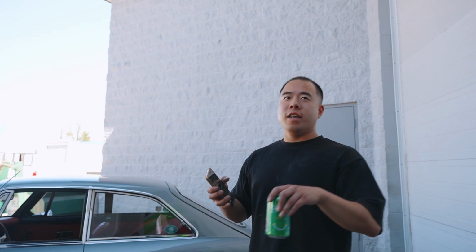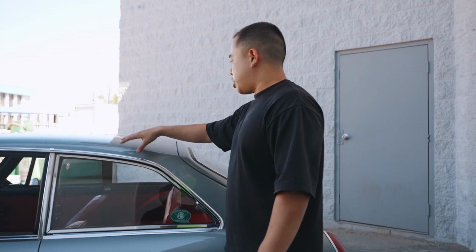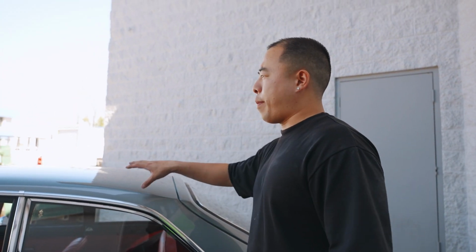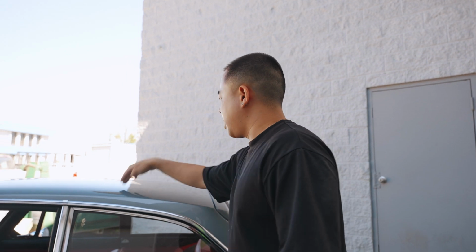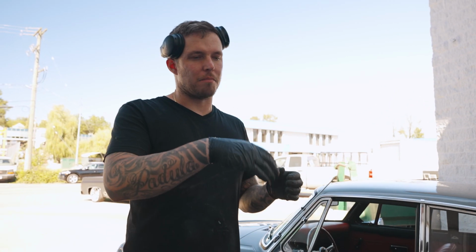I remember you couldn't just say there was an issue here and strip that area and repair it. It was bubbling here, here, here, and by the time you do all those little spots, you might as well just strip the whole panel, right? If you strip those little tiny spots and then try to repair it with putty or Bondo, it'll just shrink, and eventually you're going to see exactly where that repair was. So the only way to do it is to strip it all down.